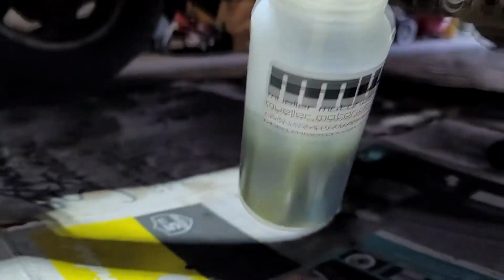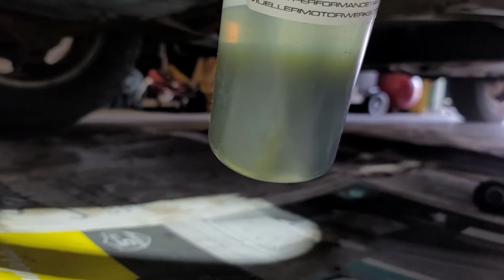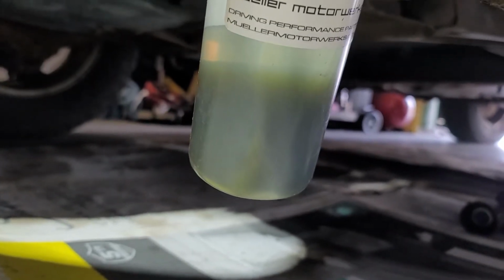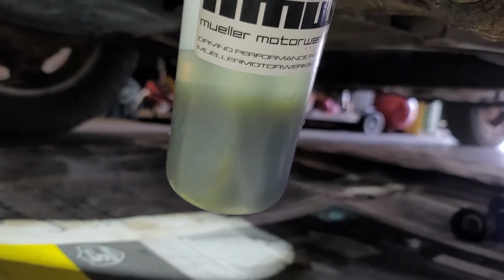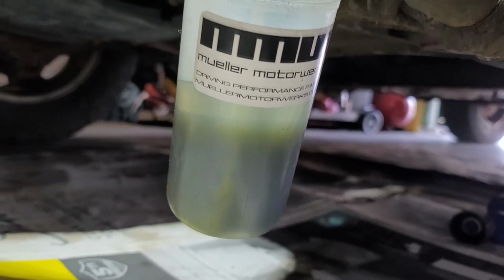It's a little slower. And then I've got the little catch can there, and again, you can see all the goo coming out of it. As far as I know, it's never been changed on this vehicle. So this is 2021, that's 13 years brake fluid's been in there, so we don't want that.